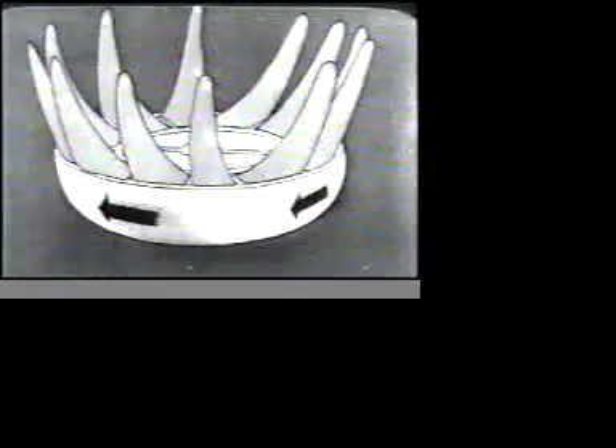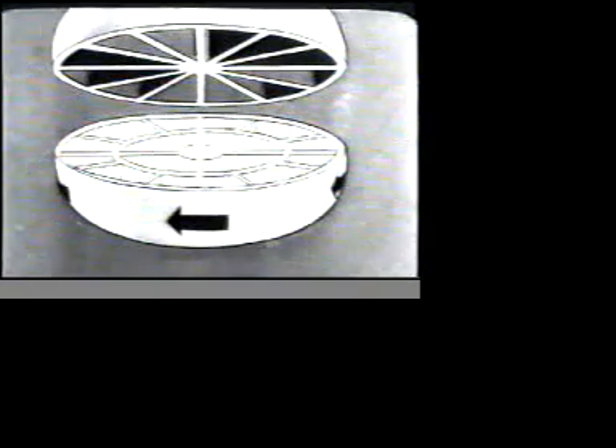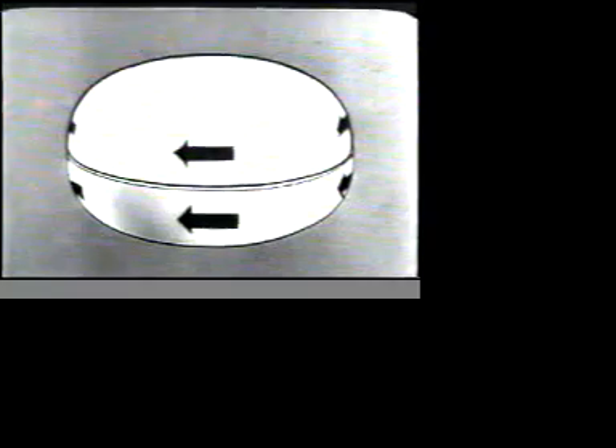These jets make a driving force which can be made to turn a second bowl, provided it has similar vanes. Here is the second bowl with corresponding vanes. Let us lower it over the first until it is nearly but not quite touching. Revolving the first, or driving bowl, slowly has no effect on the driven bowl. But as it is speeded up, the oil jets rise from the driving bowl and beat against the vanes of the driven bowl and begin to carry it round. As the speed of the driving bowl increases, the jets get stronger and stronger until at last the driven bowl is turning at nearly the same speed as the driving bowl. So we see how a drive can be smoothly taken up and transmitted simply by jets of oil, which is the principle employed in the Daimler Fluid Flywheel.